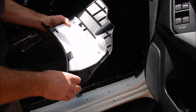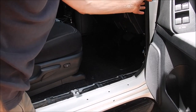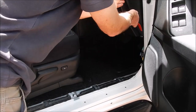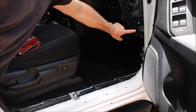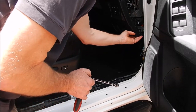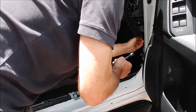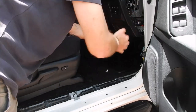Next you have to remove this piece here — there's a small black plastic threaded retaining clip just under the accelerator pedal; unscrew it by hand and pull it off. Once that's done you can pull this panel forward and off — it has one locating pin at the top. Then to go further up to the next panel, first pull the door seal off and tuck it out of the way. Use your trim tool under there and it comes off easily. Finally there are two 10mm nuts either side plus a screw in the middle to remove.